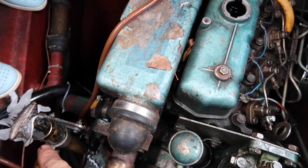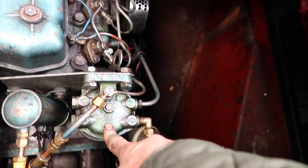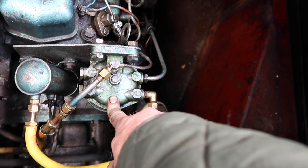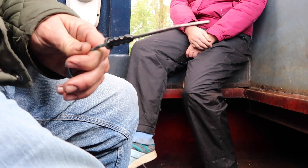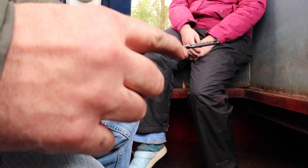Pump's turned off, we'll clean all that up in a minute and then we've just got to fill it up with oil. I'm not going to risk changing the diesel filter because it's running all right at the moment — not going to take a chance, especially when Julianne needs to run her engine quite a bit. Her oil was way up here and it's got to be basically in this range, preferably nearer the top but not over.